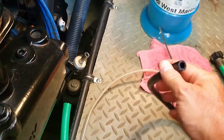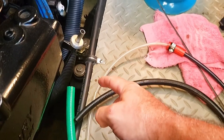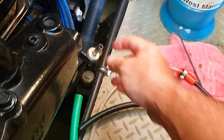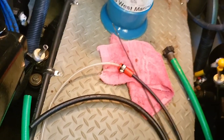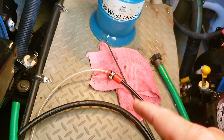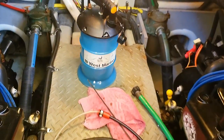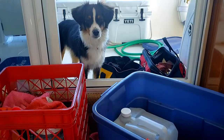The only concern using the hose methods is I don't know how much oil will be left in the oil pan, because the dipstick tube may not reach all the way to the bottom. So after sucking out the oil with the hoses, I'm going to try the skinny tube to see if any oil remains at the bottom. We'll try all three different methods.